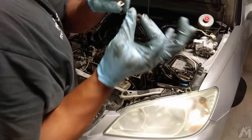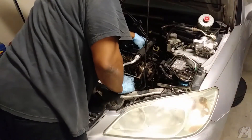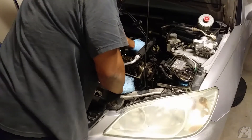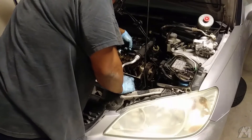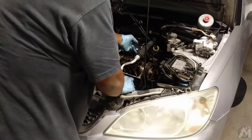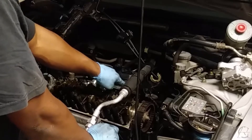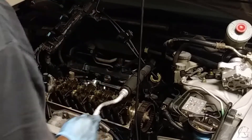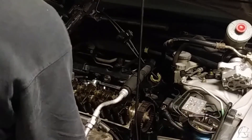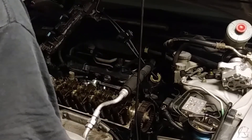Those are two 10mm bolts out of the way, and there shouldn't be another bolt — at least as far as the fuel rail is concerned. So I can begin to loosen up and move this fuel rail out of the way, because I'm going to need to get to the exhaust manifold that's in the back. Once this disconnection pops out, I can swing all this out of the way so we'll have more leverage. I'll set these two to the side, because I'm going to put those back on the posts they came out of.